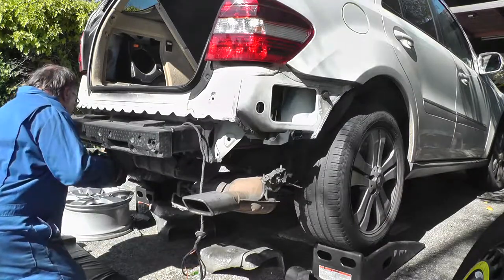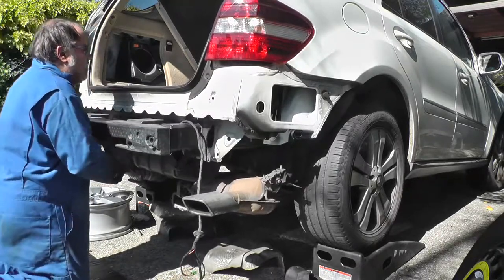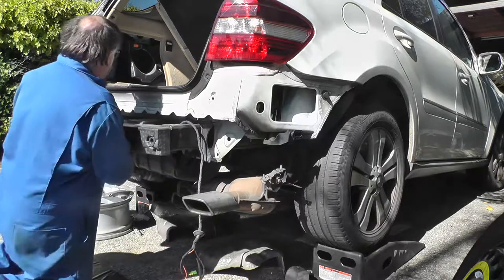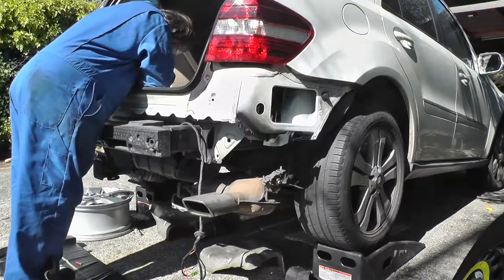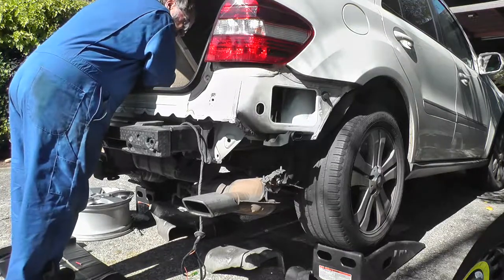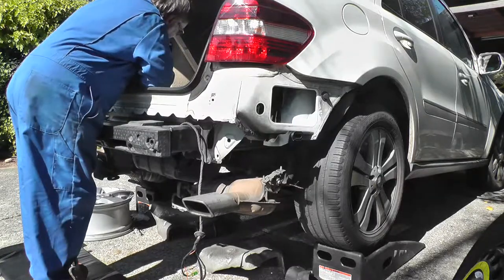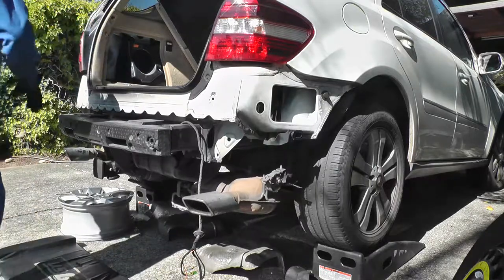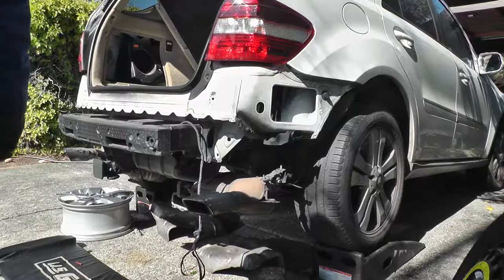Once all 8 nuts that fasten onto the through studs and all 4 of the lateral bolts are loose, the hitch just pulls out on long rails that go into the frame. I had a very hard time with this. Ultimately, what freed it was pushing it all the way in and giving it a good running jerk out, where the weight of the hitch pulled it clear of the opening.